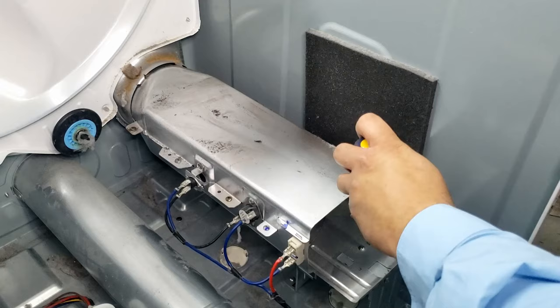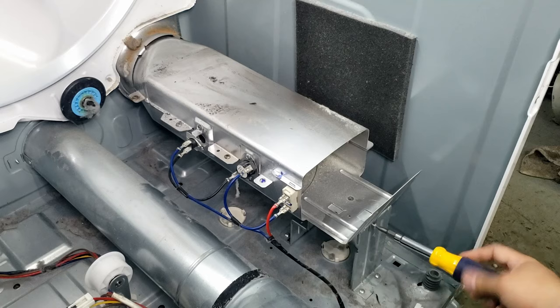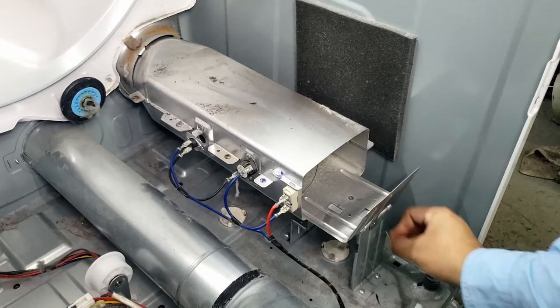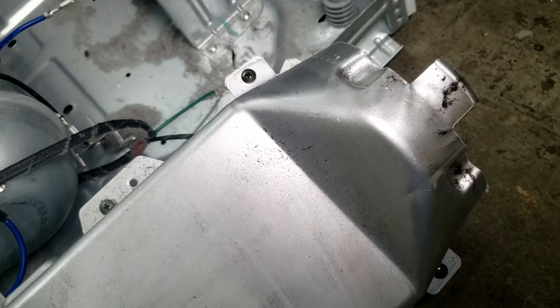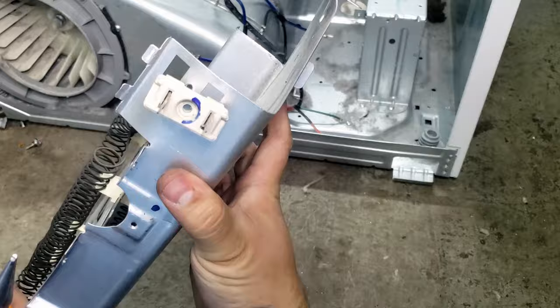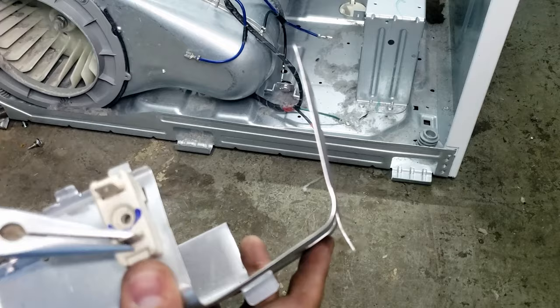To replace the element, take a Phillips head screwdriver and remove two screws holding the element housing in place — one on the top and another on the front of the canister. You'll also need to take off all the sensors from the canister. There are approximately eight screws on the heating element canister that need to be removed before the element can be exposed. Once the element is removed, you'll need to remove the element spades — they are very tiny metal pieces that need to be flattened on both terminals using needle nose pliers in order to get the element out of the canister and ceramic housing.